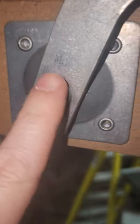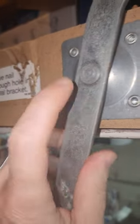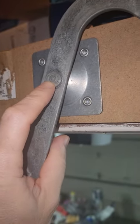The next step is to drill out this rivet right here where the pivot arm is. But the directions don't say what size rivet it is — it just says take a center punch, hit it there, and then drill out the rivet. I'm a big fan of the reciprocating saw, so I'm just going to put the saw on it and chop it in half because I don't know what size rivet it is.